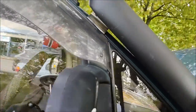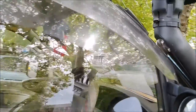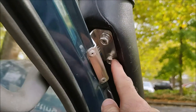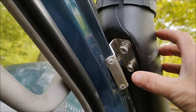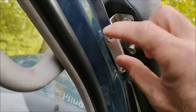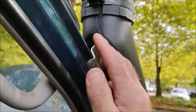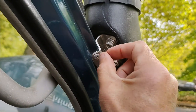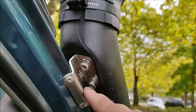Then the snorkel was sticking out about here. The day I was installing it in the videos, it was pretty chilly out. I waited until the next day — there was a lot of sun on it. Left it in the sun for about five or six hours. Got that plastic nice and soft, and wow, could you move this around better. That allowed me to more comfortably do this last step of the process. This bracket comes with the kit along with the nuts and bolts. Screwed those in to the snorkel itself. Repositioned it a couple times — became evident this is the direction. I was just able to move this around until I got this bracket in the place where it should relatively go. All I had to do was flex it over until it reached into the door channel here, made two little marks, drilled two holes, put it back in, riveted it in with the included rivets. Threw a little silicone gasket material between the metal part here — just to give a little buffer so it's not metal on metal, to prevent any paint scraping.